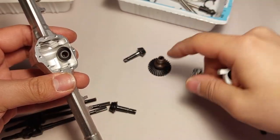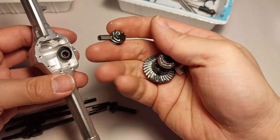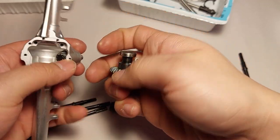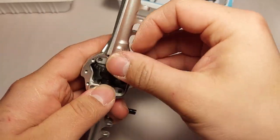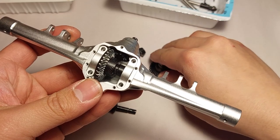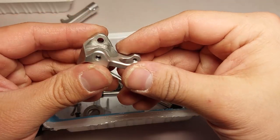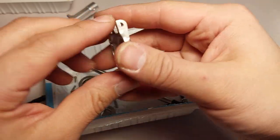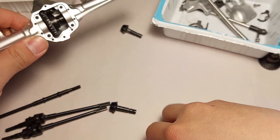With the weakness of the stock ring and pinion gears in mind, I'm happy to report that SSD gears — specifically the 27.8 overdrive version — are a direct drop-in upgrade, and I have not encountered any compatibility issues. That's great for peace of mind. When the stock gears inevitably go bad, you can put in quality components and keep the metal housings. The knuckles show no significant wear, the covers look good. Pretty much the only weak spot are the gears.